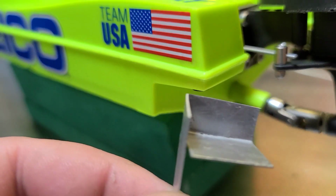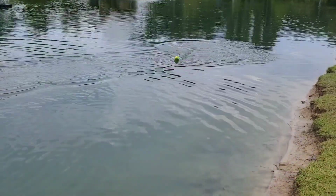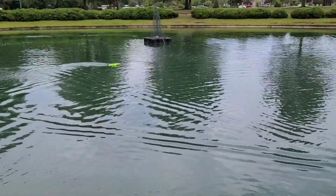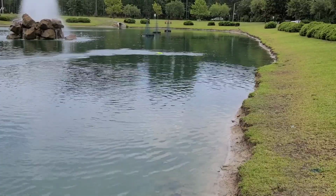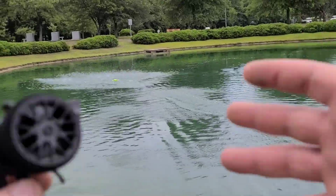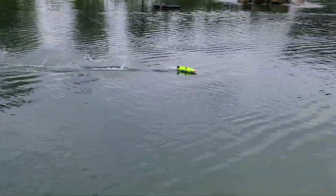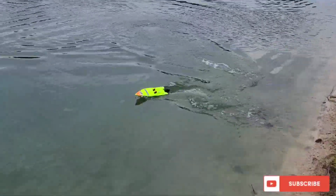So this is basically my little trim tab turn fin combo I got worked out, all right? Let's check her out here. Got her up on plane. You go to turn and it kind of catches the edge. So I think that trim tab turn fin combo that we're going to make in the next video will do the boat some good. Once she's on plane, she's actually on point. It really don't need trim, you know, like trim tab trim, but I think it may do the boat some good. So when you go to turn the boat, she wants to skip out and catch an edge. So I think the turn fin will actually help it out.